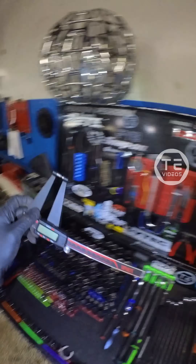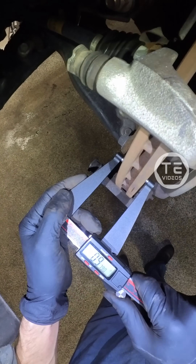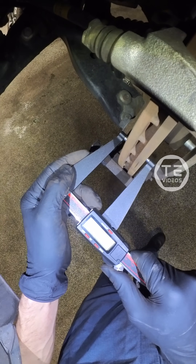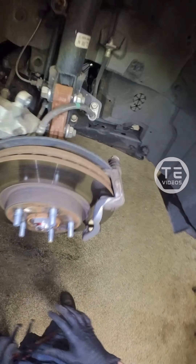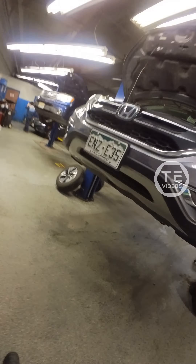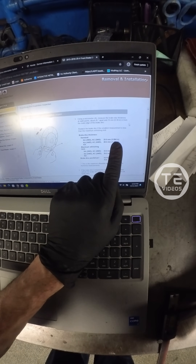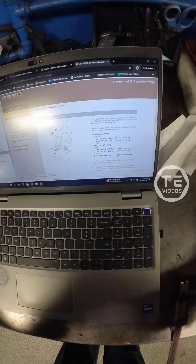Let's see — zero this guy out. Take this pad real quick. Show me what you got — it's 0.9745. Take this bad boy out — 0.977. So 0.9745. Front wheel drive new rotor is 0.984 inches. Refinish limit is 0.906. So we are more than thick enough to cut the front.